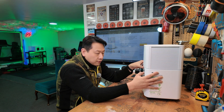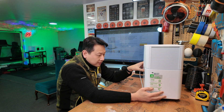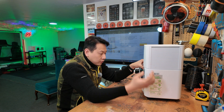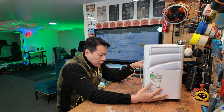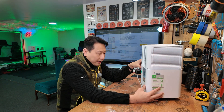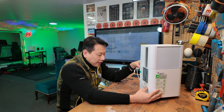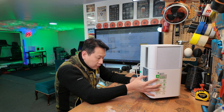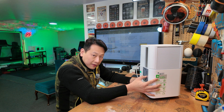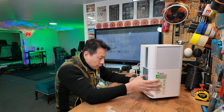This is the UK version running on 240V, and max power is 190W — not a lot. I'll plug it into a power-measuring device to see how much it costs overnight. I'll only run it at night because I get cheap electricity then. The refrigerant used is R290, just 45 grams, so even if it burns it's not going to be an explosion — it's only a small amount.